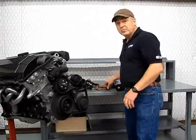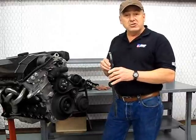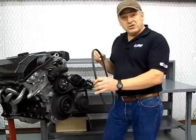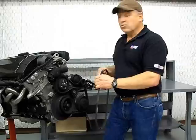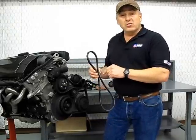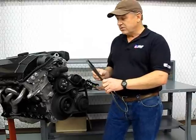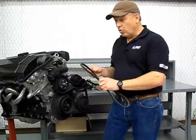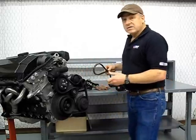On the old conventional V-belt style, it used mechanical tensioners, which required you to get under the hood as the belt stretched, loosen the adjuster, and tighten the alternator or whatever component was involved. The advantage there was the belt would start squeaking to tell you something was going on under the hood, which made you look at the belt, tighten it, or replace it if it was worn.